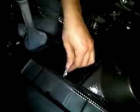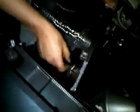So here we see the new screws right here, and we're just going to go ahead and tighten that. Make sure you guys don't over tighten it, as you could strip the innards of it. And like I said, here's that arrow again pointing towards the throttle body section of the intake. We've installed the heat shield here. Now this took a little bit of time, so what you want to do is make sure that nothing's in the way and just push it down nicely. You'll see these wires here going around, but there's enough space for it to fit nicely. And here's where we're going to use one of the stock nuts that we removed earlier and just tighten this.